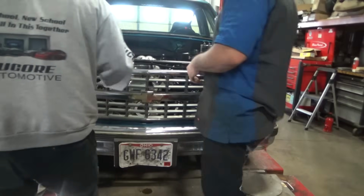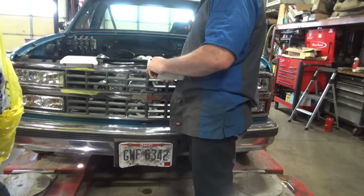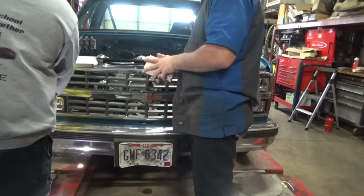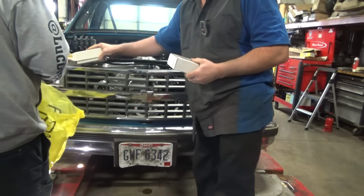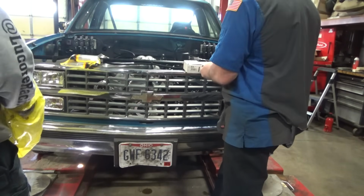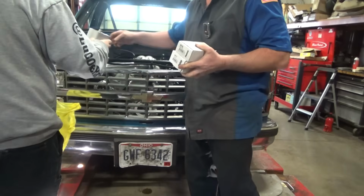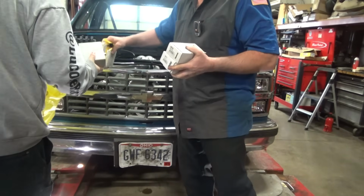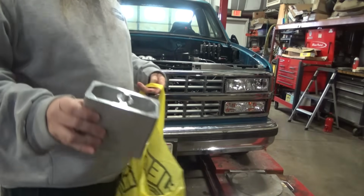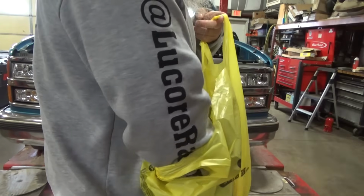There's the 3-degree shims that I bought. There's the 4-degree shims that Tommy already had. There's 1-inch blocks if you want to use those. Nope. There's 2-inch blocks. I put longer shackles in it today, which should get us right where we need to be with the 3-degree shim. Okay, well there's 2-inch. Yeah, I don't want to use blocks if I don't have to. Okay. So don't use either of those. So those will go back. Nice thing is it kept Tommy from returning stuff if you had to buy them.